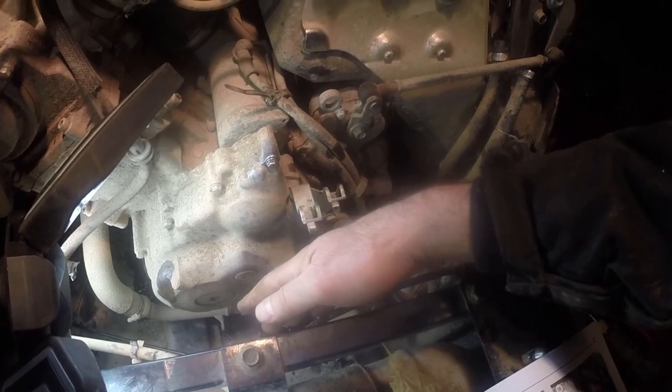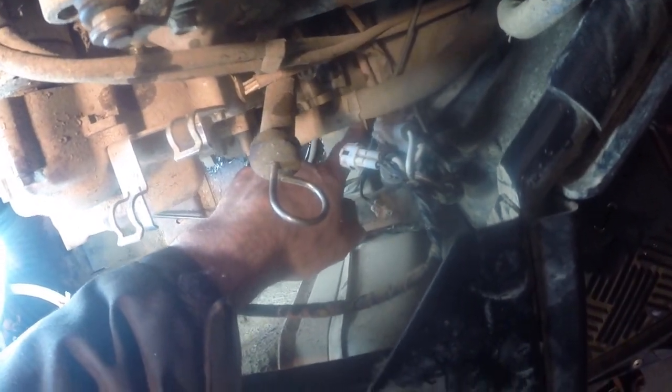From the back we remove the oil filter that connects right here. While you're down there you can remove the four bolts that hold the rear inlet oil lines on - they are five millimeter hex Allen key heads. Also while you're down there you can take the five millimeter bolt out that connects the coolant outlet pipe to the water pump housing. Then on this end, remove the coolant hose that heads up to the radiator by releasing the spring clamp, sliding it back, and sliding the hose out of the way.